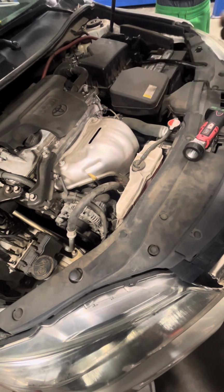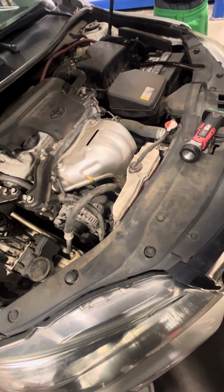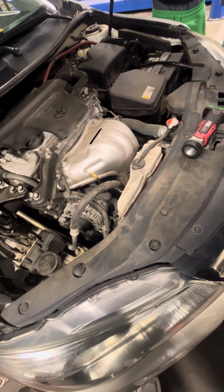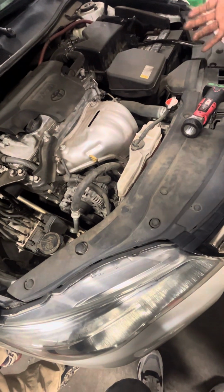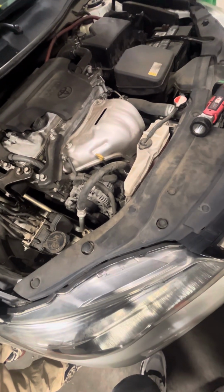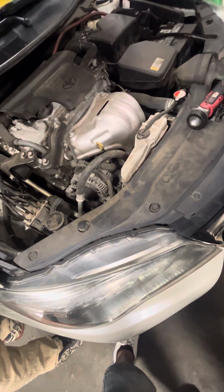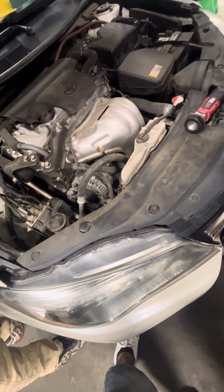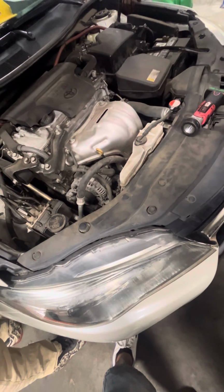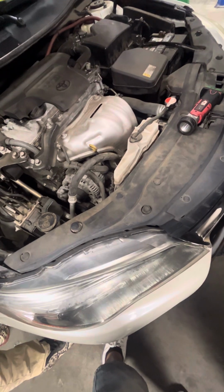One way to tell is using that thermometer and checking to see whether the whole radiator has the same temperature, or one section is hot and the other section is cold. What's cold should be no more than 20 degrees different. So if it's a lot colder than that, then the radiator is completely blocked in that section, and the only way to fix it is to replace it.